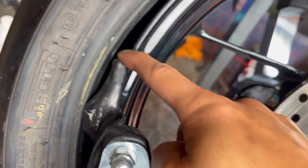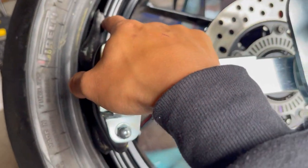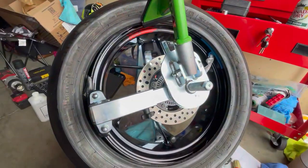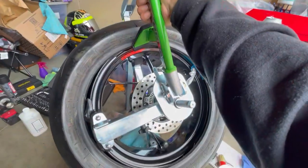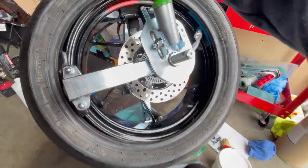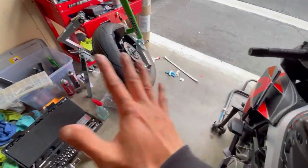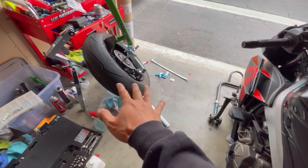The duck head is getting gouges and even has a hairline crack on the other side. That seems to be the weakest point — everything else is perfect. The bead breaker is a nifty idea and it's a quality-built tire changer overall. Realistic usage: one rear tire with no problems takes me about 15 minutes. Their ads say three minutes, but that's if you're the owner who knows it inside and out.